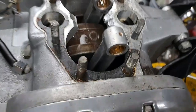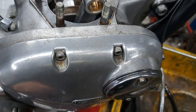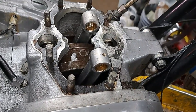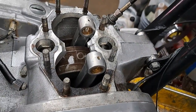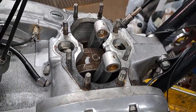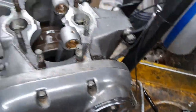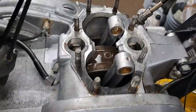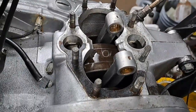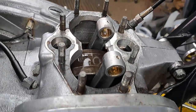What I intend to do after I take this timing cover off and clean everything up in there is to fill that entire crankcase with used motor oil — good clean but used motor oil — just for one final flush. That will make sure everything gets lubed up well, and the crankshaft flywheel isn't going to rust or anything like that.